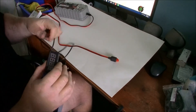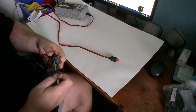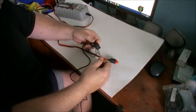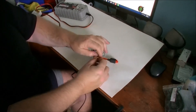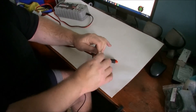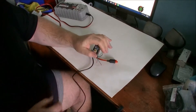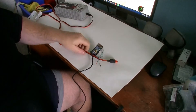Now the voltmeter isn't extremely accurate, but I didn't really buy it for accuracy. If I wanted accuracy I would have bought something a lot more expensive. Basically alternators will tend to fluctuate in their power output before they go dead, so that's what I got it for — so I can check ahead of time, and when I notice a difference in power output I can go have the alternator checked at the garage on more expensive equipment.